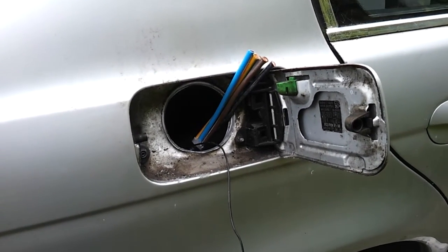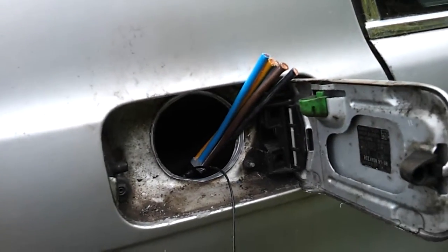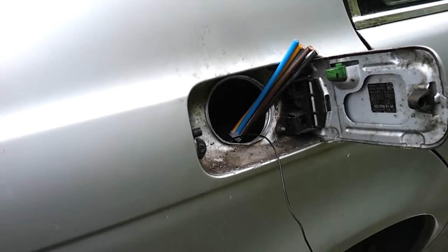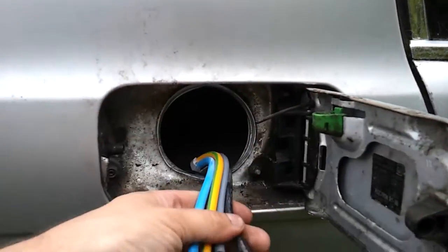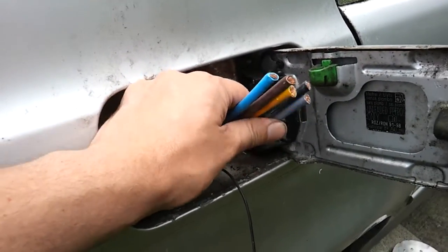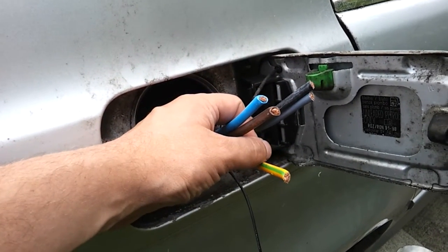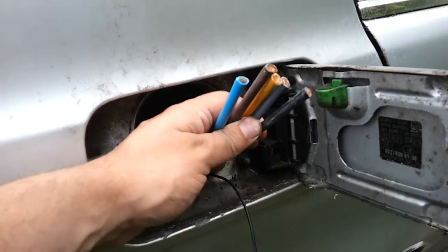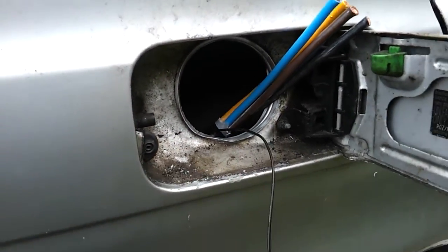If anyone has any clues about where a mere human being could actually purchase one of those, please let me know. In the meantime, we've been installing the cabling harnesses in the car, both for charging and for hooking the front and rear battery boxes up. The cable I've chosen to install at this end is 5 by 16 Silflex cable, which gives me earth, neutral, and three-phase power.